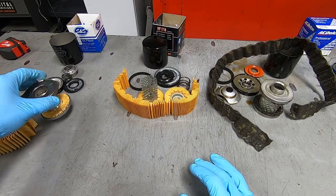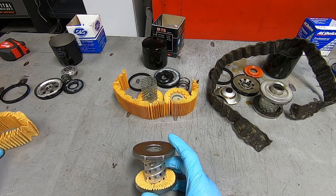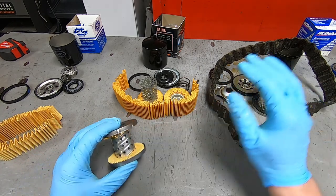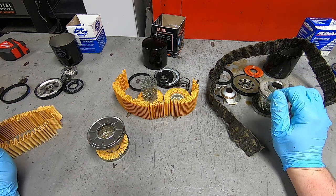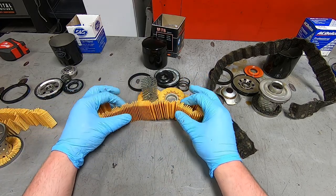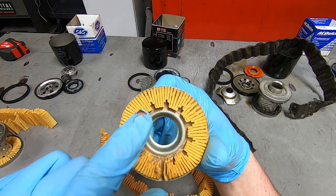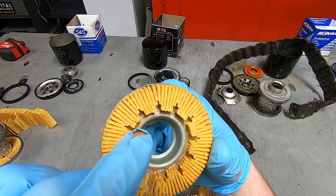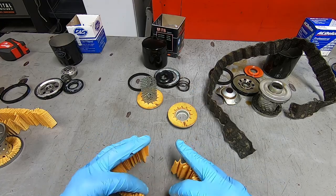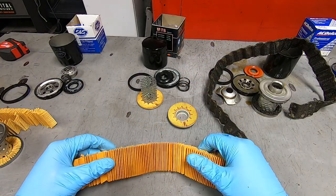All right, so we've just cut the media off. There's a few interesting things about these oil filters. The actual height of the cartridge between the Harley Davidson and the S&S is the same. The height of the cartridge of the HIFLO is quite a bit larger, and it has an interesting way that the filter media is organized, where there are these little gaps in there. You can see that in the way the paper is cut as well. And it's quite a bit taller.